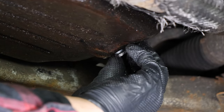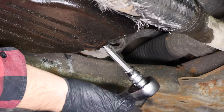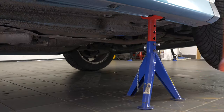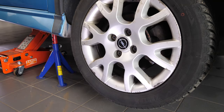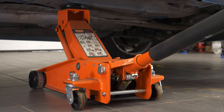Replace the drain seal with a new one, then screw the drain nut back in. Start by hand, then finish off using a wrench without overtightening. It is now necessary to pour oil back into the motor — this step must be done with care and precision. Put the crankcase cover back in place first, then lower your car to the ground and check the oil level.